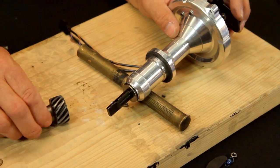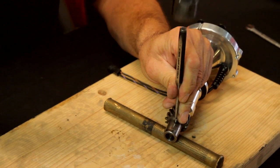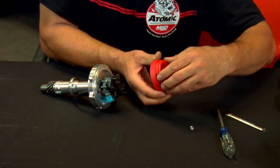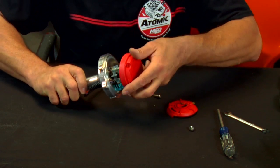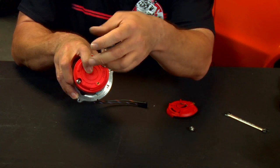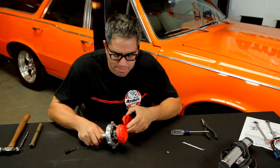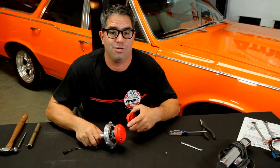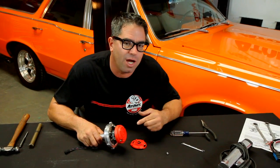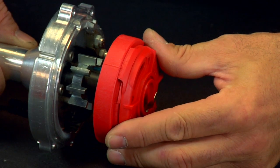The final step is simply reinstalling the gear and making sure that you install the roll pin properly. With the mechanical timing advance locked out, now we can install the two-piece adjustable rotor. We have to use this because it allows us to compensate for timing changes needed by the computer to operate the engine properly. Our Pontiac has a counter-clockwise distributor rotation — if you're working on a Chevy, that's clockwise. Make sure you know what the normal distributor rotation is for your particular engine. We're going counter-clockwise in our Pontiac, so we'll install the top part of our two-piece rotor so that we have 15 degrees of advance opposite to normal distributor rotation.